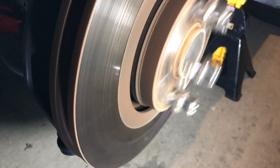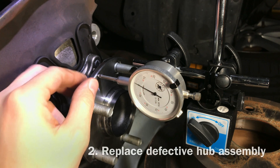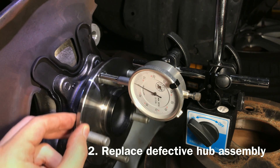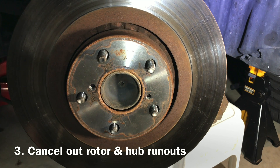There are several ways to correct excessive run-out. If run-out is more than .002 but less than .009 inches, it might be possible to correct it using shims. Replace the wheel bearing and hub assembly if it has excessive run-out or bearing looseness. If the bearing hub run-out is normal, you can try to change the installation position of the brake rotor — combine the highest point on the rotor with the lowest point on the hub, or vice versa, and it may decrease overall run-out.